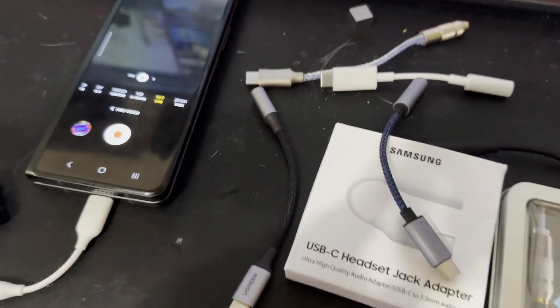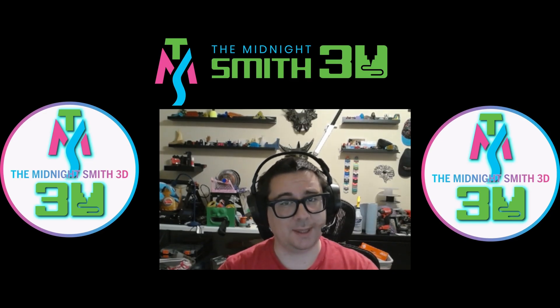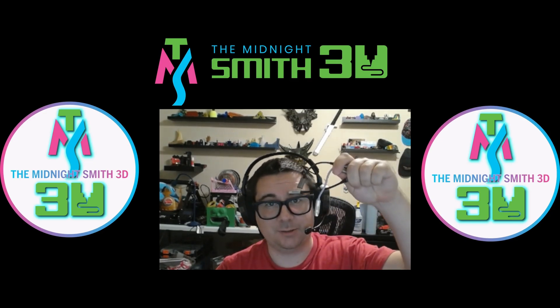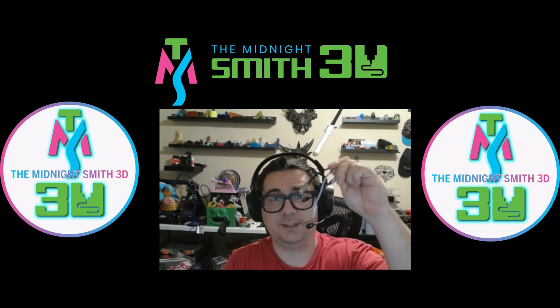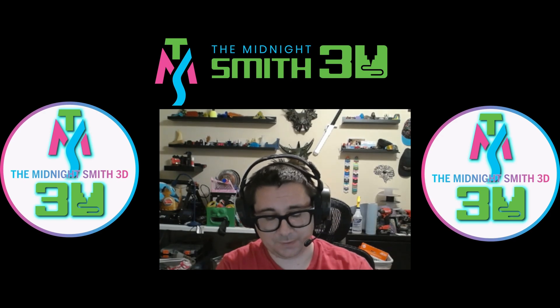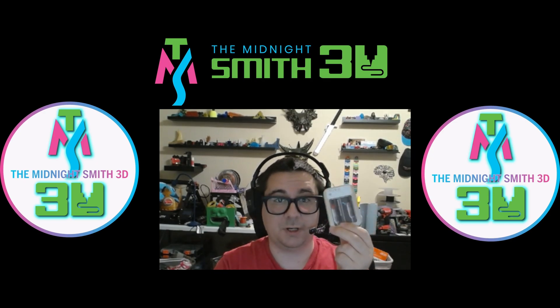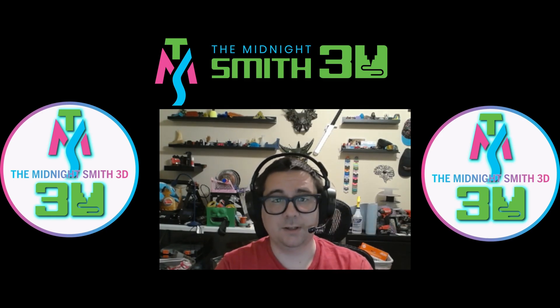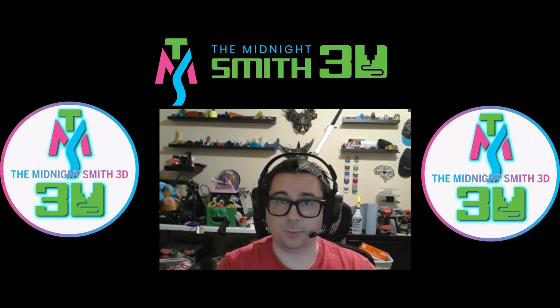As you can see, not all adapters are made equal, even though they may say DAC adapter. So that is how you determine which one of these adapters will actually work on your phone. It's not necessarily a Samsung issue — it's simply that there is no standard for these adapters. They may play audio, but they will not pick up an external microphone. That is a major problem. USB-C manufacturers are not being held to any standard whatsoever, and that really upsets me.